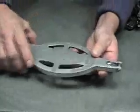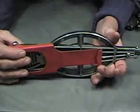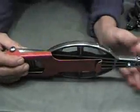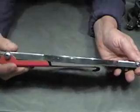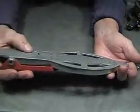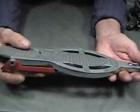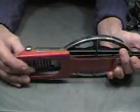What I do, on the footboard for instance, is this. Here's one that I have modified and done my thing with. Sides are all polished. All of the pedals that I take are completely bead blasted, and then the parts are put into a sonic cleaner. So everything is back down to clean bare metal when I start again. As you see, this is straightened out, repainted.